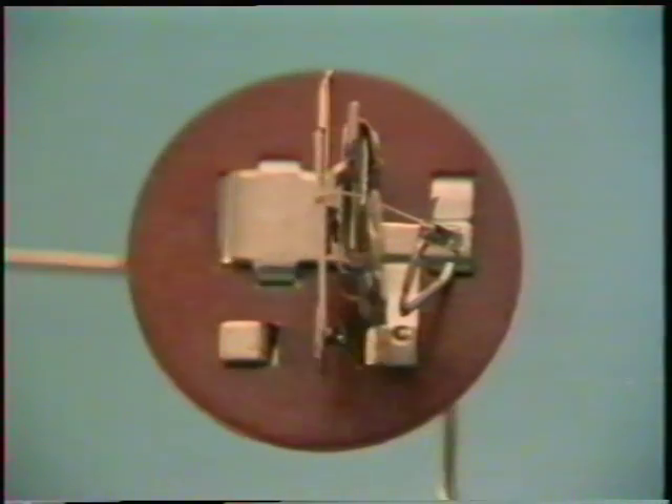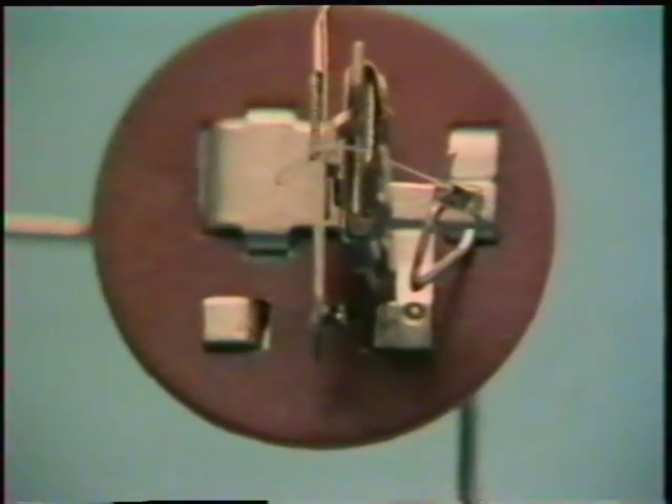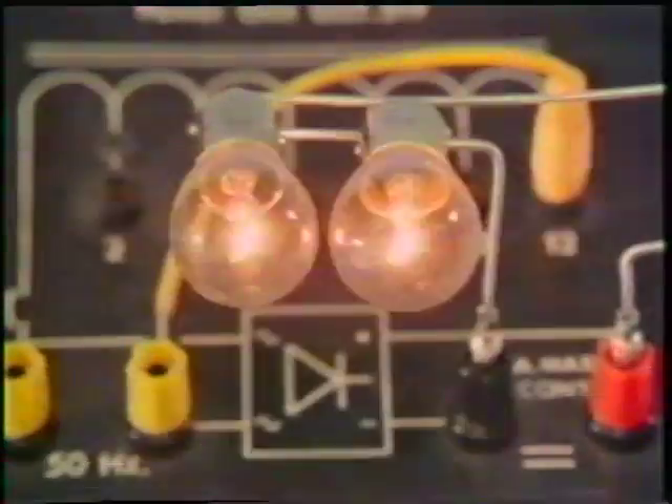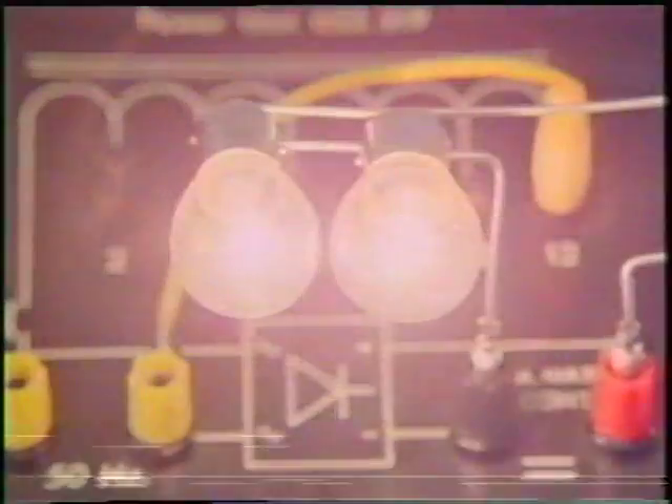But at the same time, this cuts off the heating current, so it straightens out again and breaks the connection with the bulb. But this restores contact with the heater current, and the strip bends again, and so on, until we switch off. Other flasher units work in different ways. Examine one for yourself to see exactly how it works.